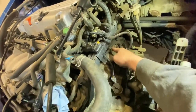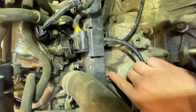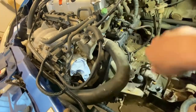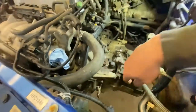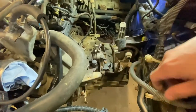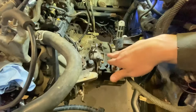For your bell housing, like this one and that one, right there. Just go around to the underneath, around the bell housing, and you'll see some bolts. Remove them, and there's probably one by the starter. After that, go ahead and remove the bolts for your transmission mount.